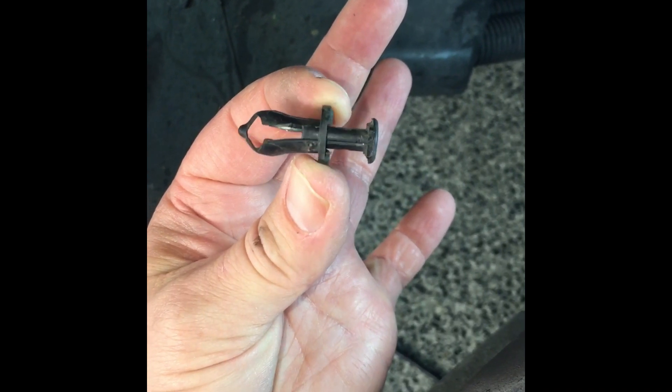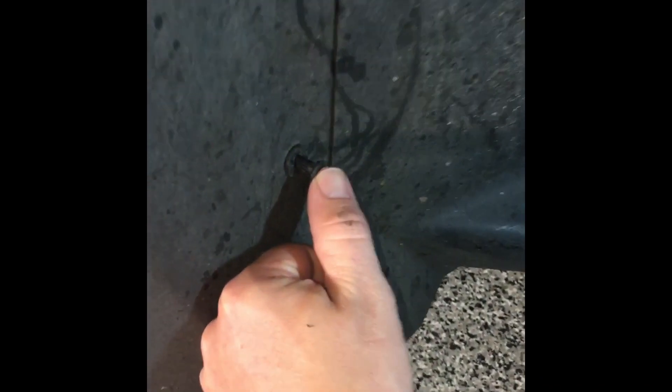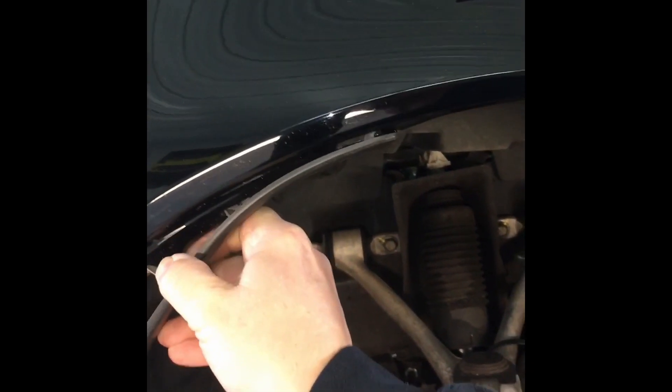When you get it started, it should look like this. Then it's as simple as just putting it back in and pushing it in with your thumb. With the clips and the bolts underneath removed, grab the inner fender and it should just pop right off. There will probably be some double-back tape on there from the factory. Now you'll have greater exposure for the next step.